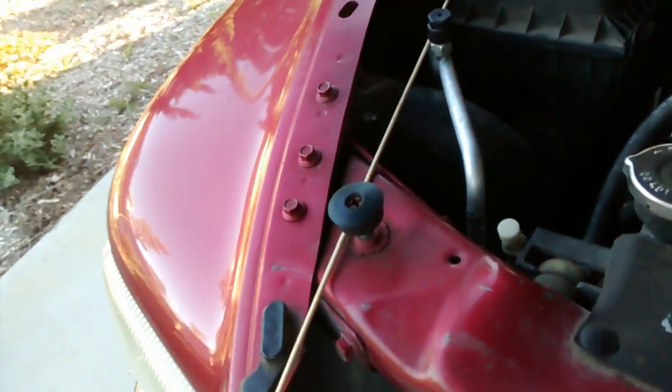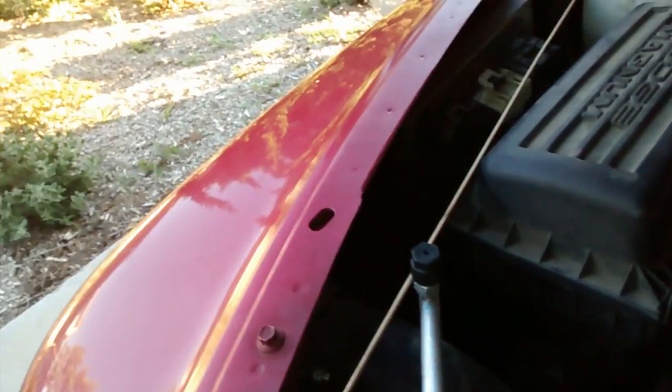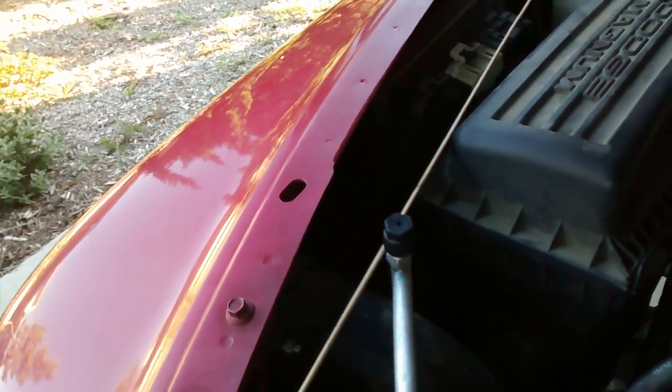So he's like a 15.5 millimeter 8-point. Maybe you could use a 5/8 8-point if you got one. I went ahead and bought this socket after the fact because he's leaking. So of course the one thing I didn't replace is leaking. So I'm gonna have to discharge the system, or I'm gonna have to deal with that again someday. Luckily I bought a vacuum pump and all that. It's pretty easy to do. Look for Eric the car guy. He's got a good video on how to recharge.